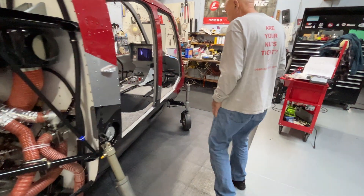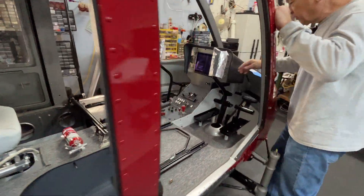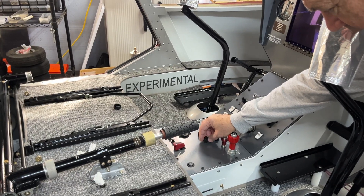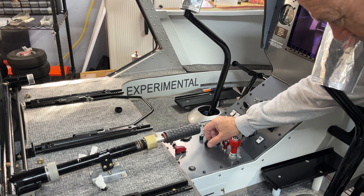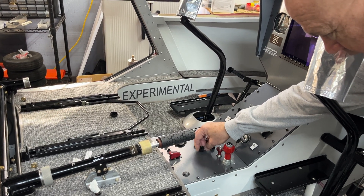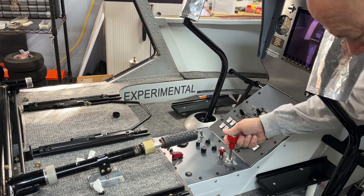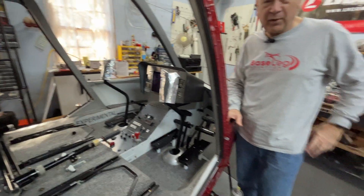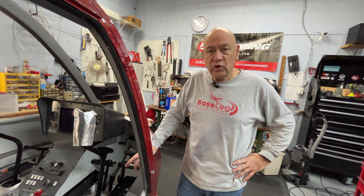Moving into the cockpit — this is finally all complete. The instrument panel is completely done. We've got a nice knob to control the heat, which will be electronically controlled for cabin heat from cold to hot. I also put in a real nice mixture control. It's a helicopter, so I didn't put that in to lean in flight, but I always lean these engines on the ground. It helps with plug fouling, and with some full power run-ups I'll be able to tell if we've got the Airflow Performance unit jetted properly.